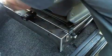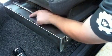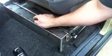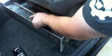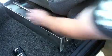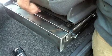Now another thing that could happen is that you could put a lock cylinder either in this surface or this surface to engage either the lid or the latch. This surface is difficult because there is that reinforcing rib right underneath it from the body, so punching down through that with a lock cylinder isn't really a good option. The other thing is you could put it there, but if you notice, that's as far back as our seat goes, so it'd be pretty awkward to get your key in there.